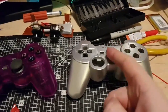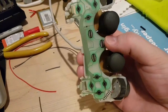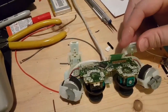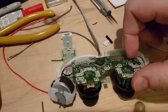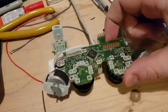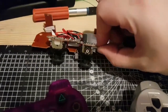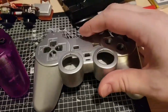Let me show you what a legit DualShock 2 looks like inside. The DualShock 2 uses a membrane contact pad — I believe that's because it's using pressure-sensitive buttons, or maybe it's just a cost-effective thing. It has this kind of skeletal plastic system that goes inside and holds everything together — the motors, everything — and then this membrane touches down and pressure holds it into the tiny little PCB. The bootleg uses a complete cross PCB with a tiny little daughter board just for the sticks. So how do you fit something that's obviously wider into something that's not built for it?